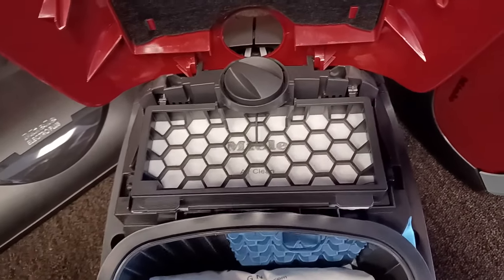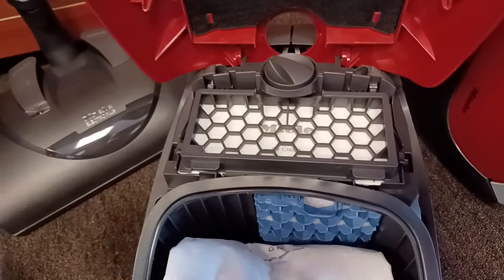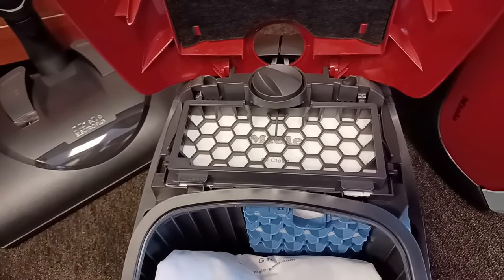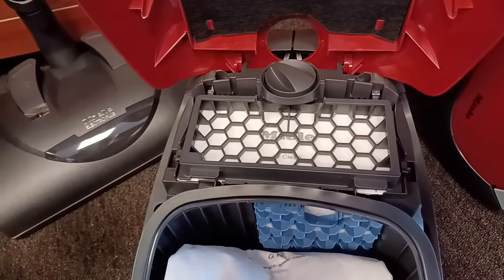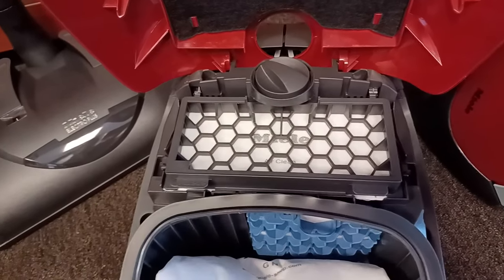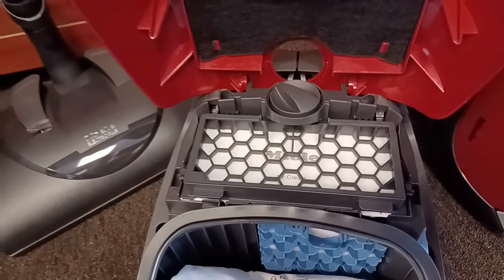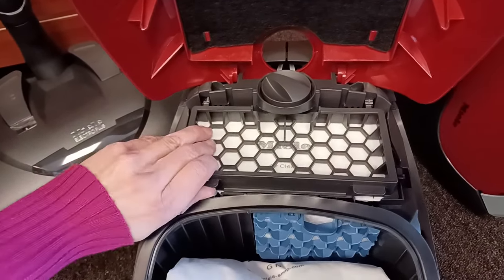The reason you have an exhaust filter is that the number one thing you want to capture is the byproduct of the motors. These motors have what are called carbon brushes in them — it's part of how they conduct electricity, and they erode away over time. Literally, the black dust that they're made of — the carbon — will come off as it scrapes against the insides of the motor and otherwise blow out into your breathing air, which we don't want. So a filter here collects that debris.